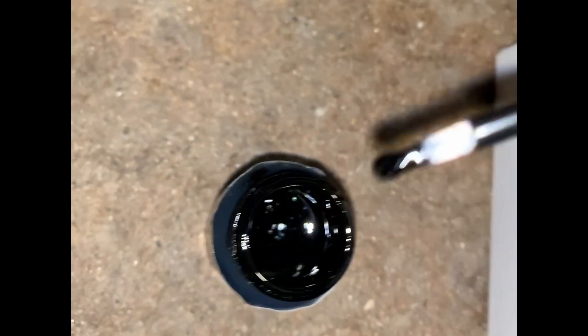You can always undo what you do here. The squeegee — I recommend using it because the kit does talk about it, but long term it's really not the best solution. You want to wipe off the excess paint every time you reapply with the squeegee, and act quickly so the paint doesn't dry. You're going to very quickly swipe it across the affected areas and you'll see the scratch is still showing through — that's unfortunate, it's not going to be perfect. What this is doing is creating a base layer, filling that hole with paint. This is the first step.